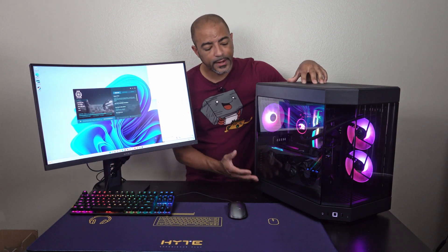This could use some tweaking in terms of fan curves. With an AIO like this, you can manually adjust the fan curves to your liking — that should hopefully take care of the thermal throttling. The fan noise was very very low; the fans were barely even trying, so there's a lot of headroom. They may have this on a quiet profile. Playing Star Citizen, temps were fine with no thermal throttling and very low audio levels, basically room ambient noise. But Cinebench R23 as a CPU stress test revealed the fans could ramp up faster.